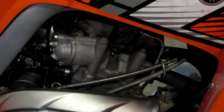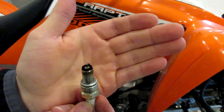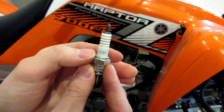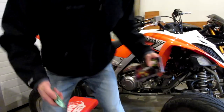Here is the old spark plug, and holy crap this thing has seen better days — it's definitely blackened and definitely needs to be changed. What was in there was an NGK CR8E, pretty sure this is just the stock plug it came with, so it's four years old.